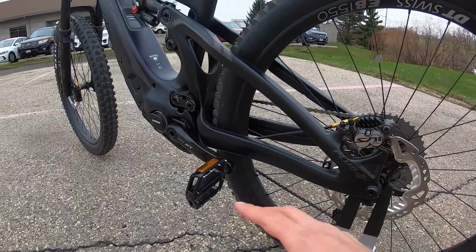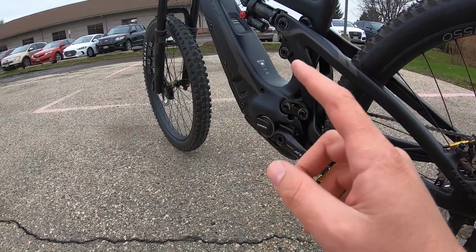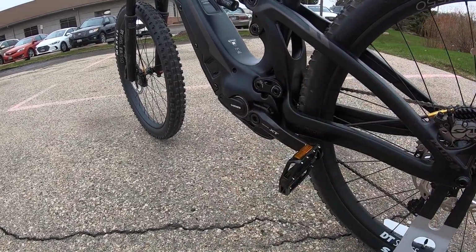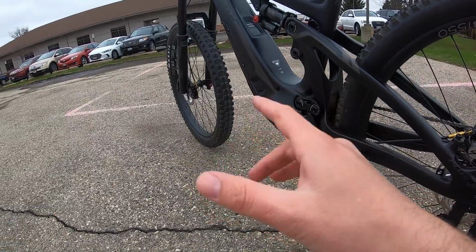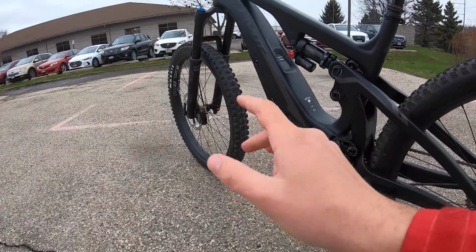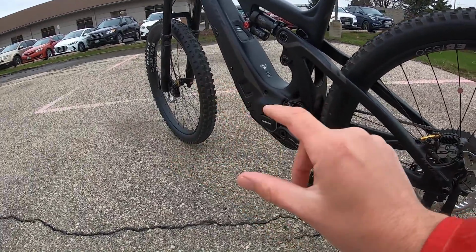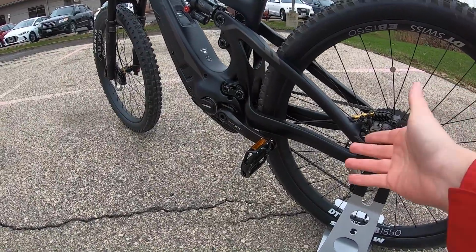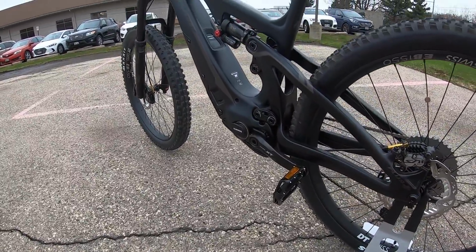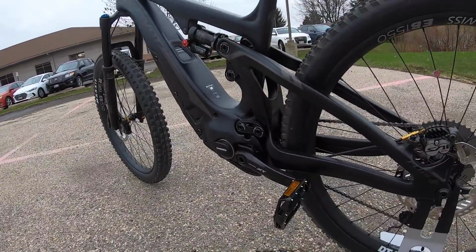The reason for that is when you're mountain biking, the front wheel does more of the stopping power, the front of the bicycle, as you're coming down a hill. So you would want something with more power up in the front to give you more bite as you're going downhill, because the burden of slowing you down is on the front of the vehicle as opposed to the rear. So having this one smaller and that one bigger is a design choice that they made to increase safety, because that way you're braking at a more even rate instead of being flung off the bike. I think that's kind of an extreme case, but that's a design choice that was made pretty wisely.